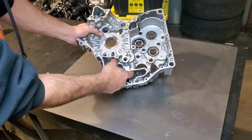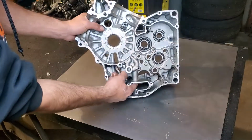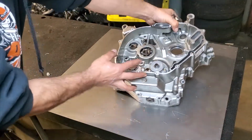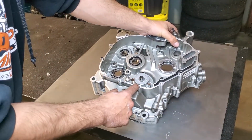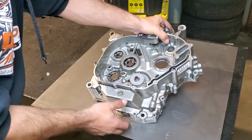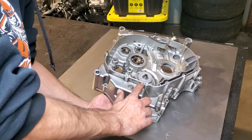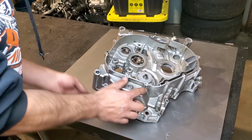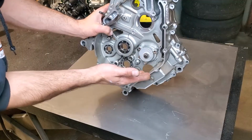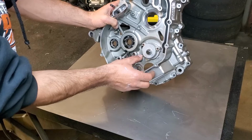So this is going to be the area that we're interested in seeing dry. And on the back side of it, this happens to align approximately with this bolt. So the tube ends right around this area. So if I pick this area up to the point where the oil's out of the motor, there's no debate that the pump isn't getting any oil.